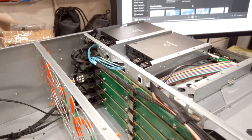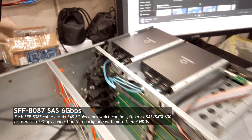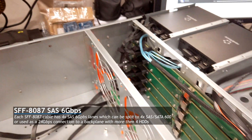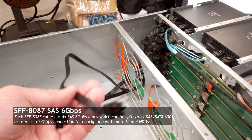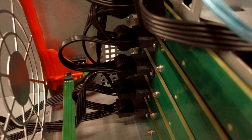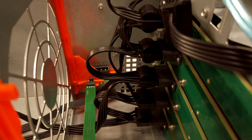Internally, those have five backplane PCBs where you can connect one SFF 8087 cable. While cabling this, I use two Molex cables for my power supply. The first reason is it only has four connectors and I need five. But the other reason is because I'm running a mirror, this gives some redundancy advantages later on. I'll talk more about that in another video.